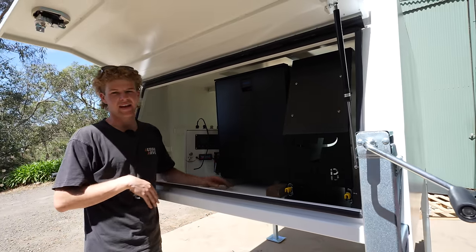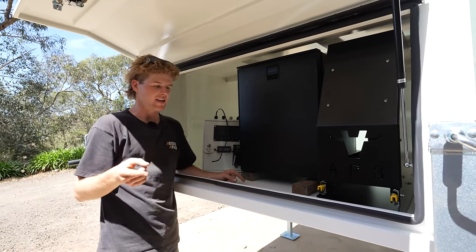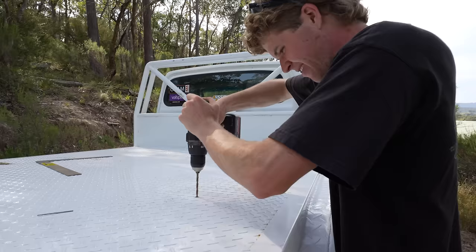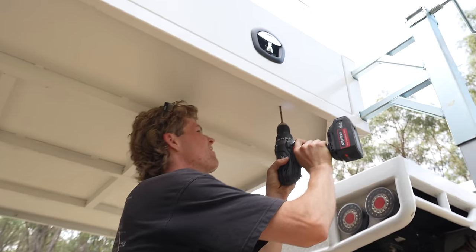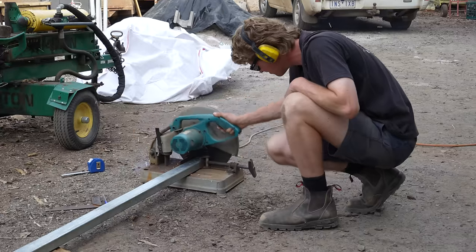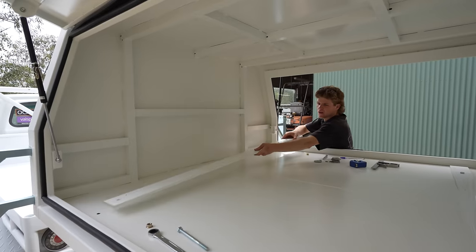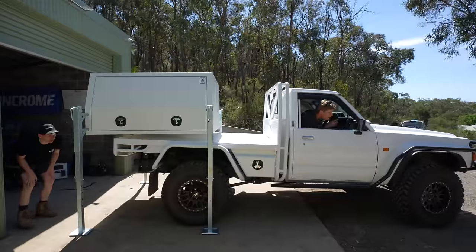That's going to allow us to test this stuff out, and then when we come back into the new year and I've figured out what my final setup is, I can redo all of this. Before I could sit the canopy on the back of the patrol, I first needed to drill through the tray so that it could be bolted down securely. I made sure to drill through the frame rails of the tray for maximum strength. With the holes in the tray drilled, I then drilled the corresponding holes in the floor of the canopy so that it all lined up. Because the rails of the tray don't line up with the bracing on the floor of the canopy, I'm using blocks between the canopy floor and the tray to ensure the floor doesn't warp or tear when tightening down the mounting bolts. I'm also using a 10mm aluminium plate as a saddle strap to spread the load across the canopy floor bracing — so this thing won't be going anywhere.